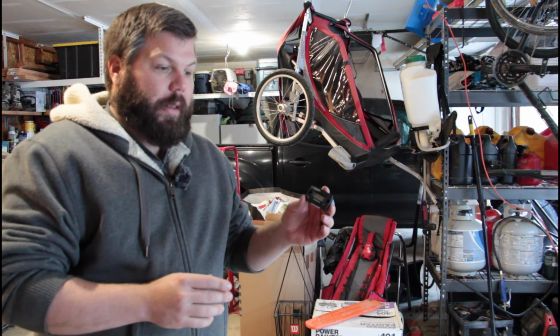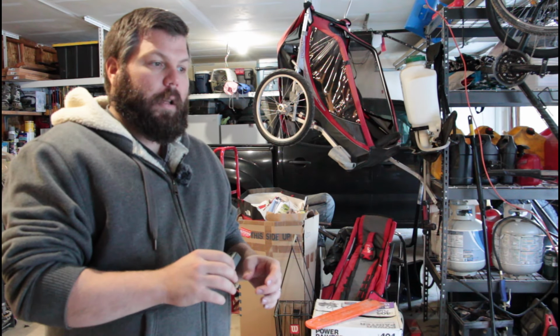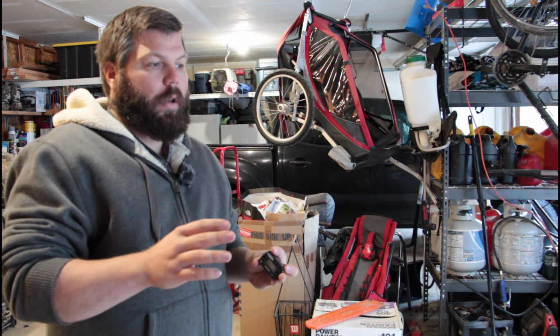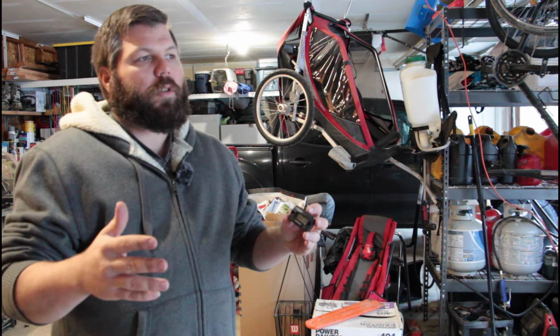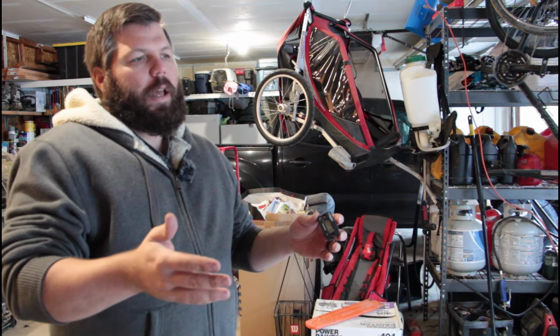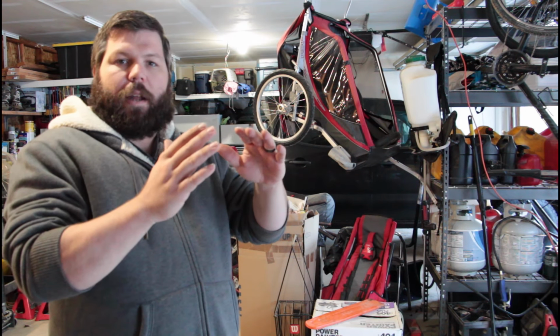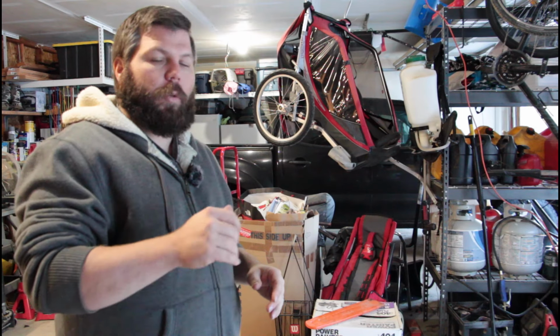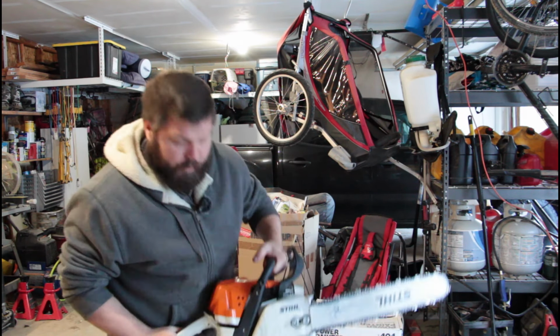So I'm going to be looking at this, I'm going to be listening to it with my ears, and I'm going to find the 2 points in the low idle. In between there's going to be a high point. It's kind of hard to explain. So one end of it is going to start dropping off, the other end is going to start dropping off, and in the middle it's going to be that peak, right? So we want to go to one or the other sides of that peak. And then what we're looking for is throttle response with the low mixture. These are jets, by the way.